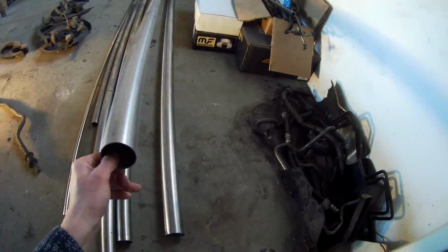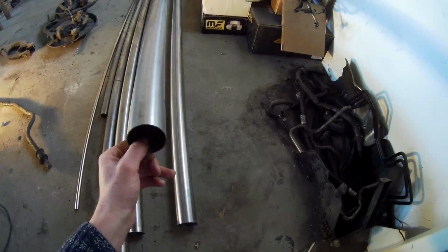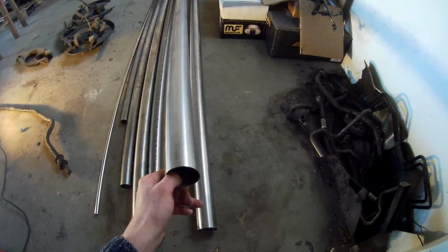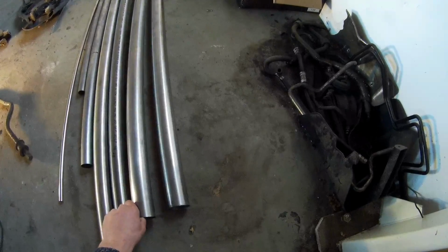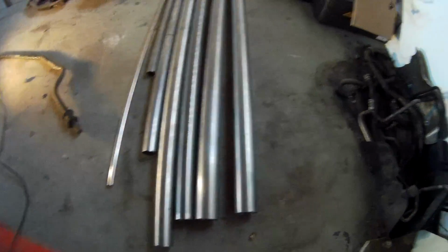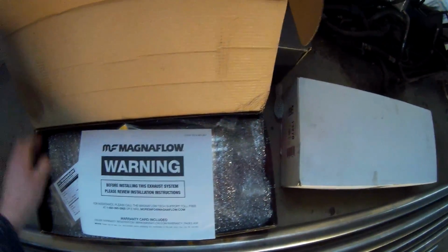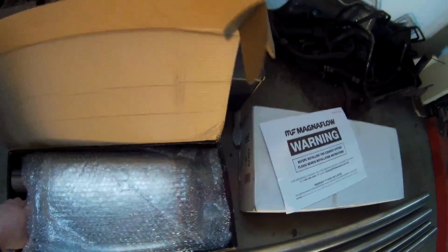Then I will go over from 2 to 1, and that's 2.25 inch inside, I think. So this is outside. This is 60 millimeters. That's 2.36 inches, I think. And then it will go to an X pipe damper. I ordered dampers. I also used this on my car before, the Beetle that I modified. I also had Magnaflow, and I think it's good quality for the price you get, and I hope the sound is not too loud to get through the registration.